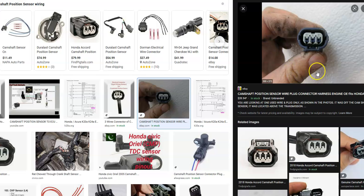One thing to also mention is that these are usually on a fuse somewhere. The fuse could have blown, especially if there's a short circuit — usually inside the engine compartment, sometimes underneath the dash. You want to check around and see if there's a fuse on this circuit, because if it blows you're not going to get any power to it. So be sure to keep that in mind.